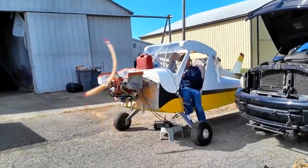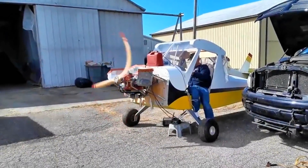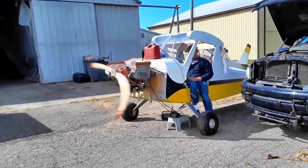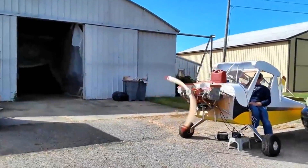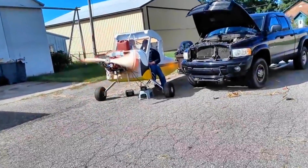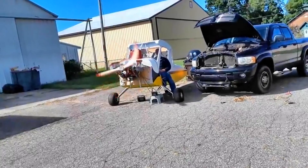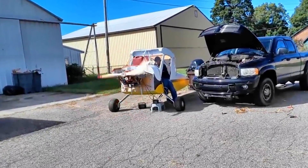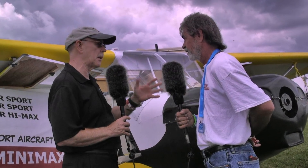Give me a sample demo flight by the numbers at full gross. Takeoff roll is about 250 to 300 feet, cruise speed is around 90 mph, and climb rate is going to be somewhere around 700 to 800 feet per minute. Those are very strong numbers out of an 85-horsepower engine with a low fuel burn — three and a half gallons an hour at cruise. So a climb you'll burn a little more, but once you're up at altitude, 90 miles an hour at three and a half gallons an hour — that's correct.